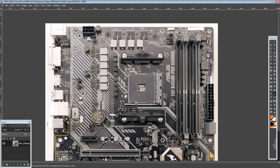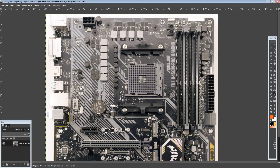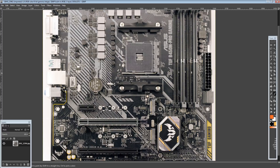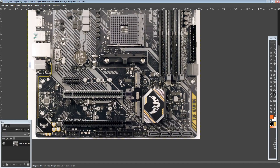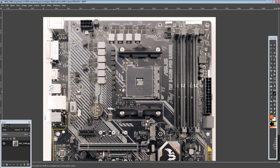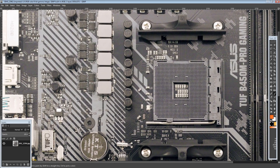Unfortunately it's not very good, because it's a low-end Asus motherboard. Even high-end Asus motherboards these days are rather cheap in the VRM department, but when you go low-end it's a whole different story. There are no overclocking quality of life features anywhere on this motherboard — no debug LEDs, no post code, no buttons, no dual BIOS, no socketed BIOS. So if you break this board you're going to have a great day. Anyway, let's just get right into the VRM, because that's really all there is to this thing, and there's not really much to that either.